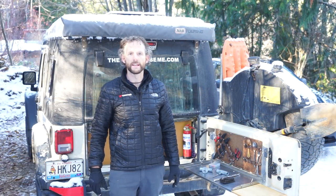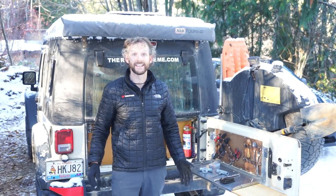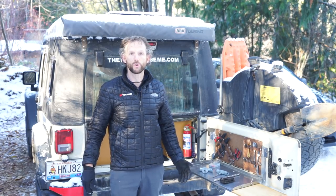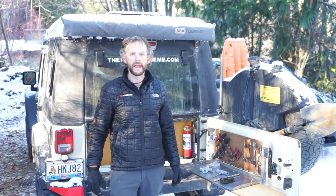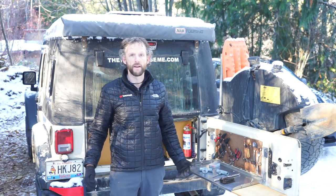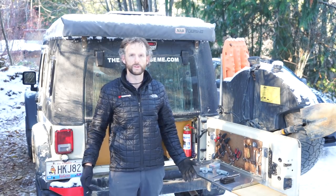So, what do I do in the event of a flat tyre? I definitely have had them. From Alaska to Argentina I was running really cheap tyres and had 16 flat tyres in 40,000 miles, and all the way around Africa I had three flat tyres. They were always nails or screws or something like that embedded in the tread. To fix flat tyres like that, I carry a plug repair kit. I have the kit from ARB, which works really well — I actually filmed a video in Botswana using it when I fixed one of my flats there. It works really well for any kind of damage on the tread, anything that's a hole from a nail or screw.